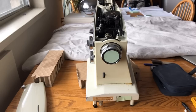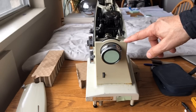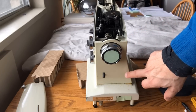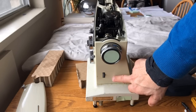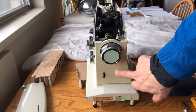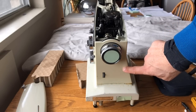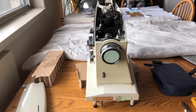I've gradually been able to get movement in the machine, and that's good. I still haven't gotten the zigzag going yet. I mentioned I wanted to do a video where we look at the side. I can see where grease was put underneath — when we did the video from underneath, you could see where grease had been applied somewhere in toward the belt — but I couldn't tell if it was on the belt for sure, and I want to know. That's a big question.